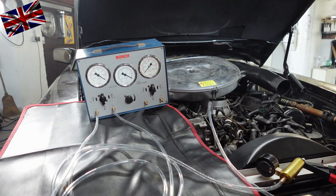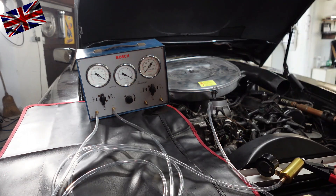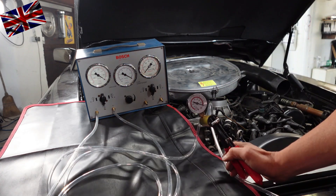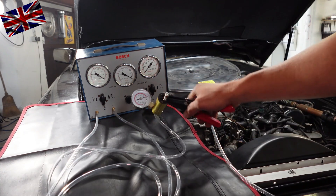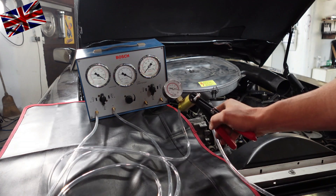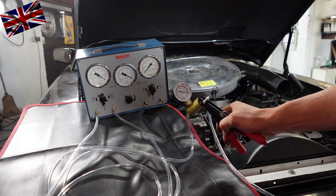If you grant yourself the luxury of getting a Bosch testing unit straight from the 80s, you can bridge the ports and change parameters — I just love it. But a generic hand pump will do the job as well. A little demonstration: cannot create a vacuum with the thermostat when coolant has reached 50 degrees Celsius — vacuum not available. Now let us wait until the temperature falls below 50 degrees Celsius and then the valve closes, allowing a vacuum to be created.